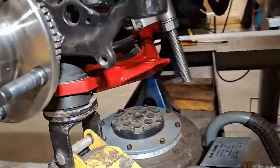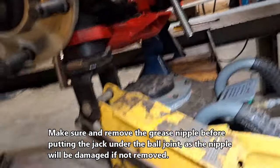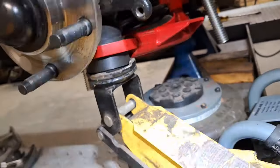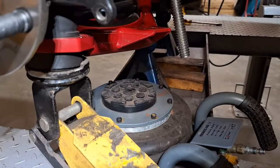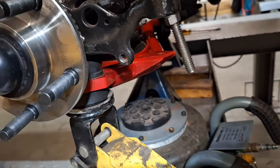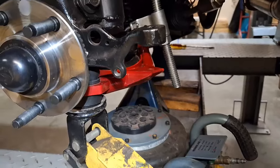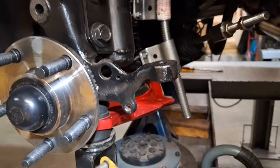I've got two of them, one on this side and one on the other side. The setup I've got here with the jack is a hydraulic jack, and I've got the saddle here cupped around the ball joint so it can't really move - it's pretty solid in there. I'll just jack this up a little bit so you can see what I'm going to do. Once the spring tension is off, I can jack this up and lower it like that, but we want to put tension on it, and the saddle is around the cup of the ball joint so it's not going anywhere.